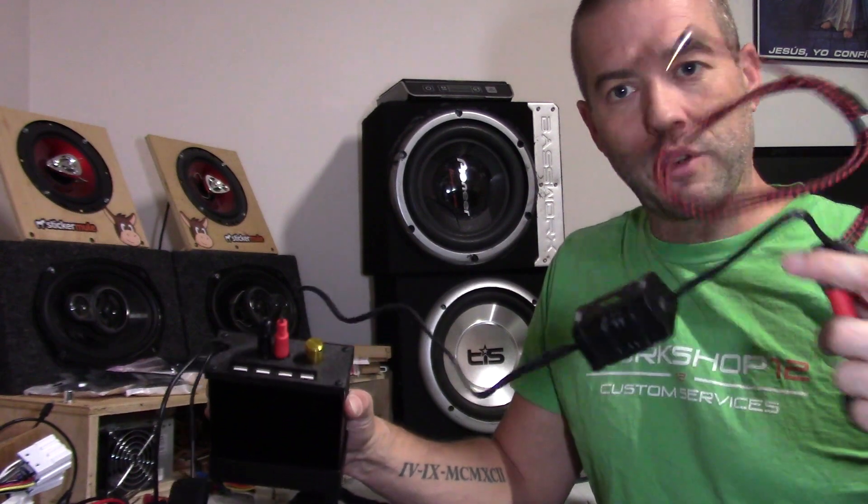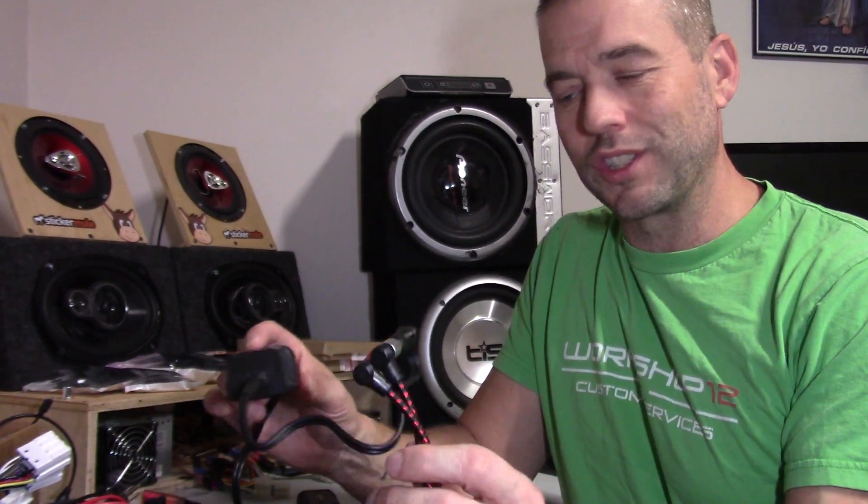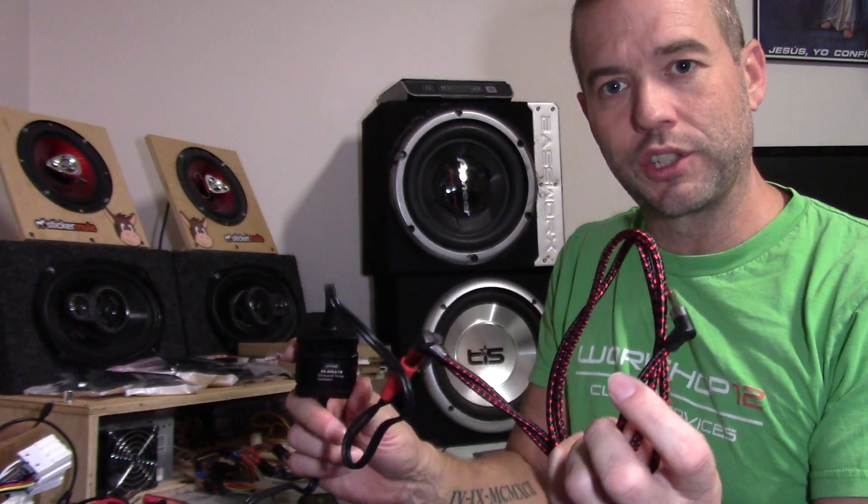This is a great little unit that filters any noise coming from the tablet's headphone jack and minimizes electrical interference on that channel. I recommend trying to tuck the isolator and wiring away from other electronics — away from ECUs, away from climate control units — because if you place the cable close to something causing distortion, it will pick that up again before it reaches your audio equipment.